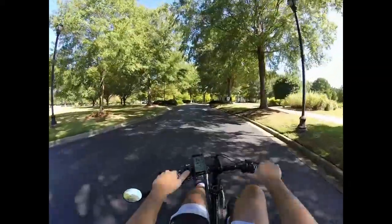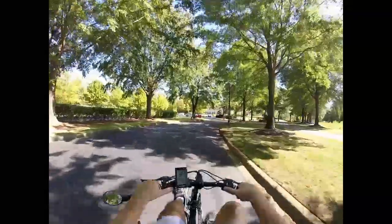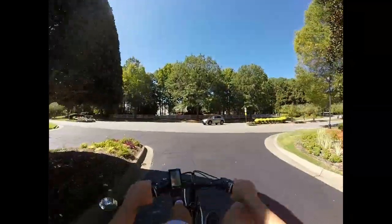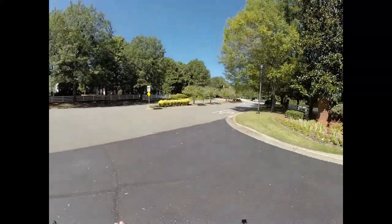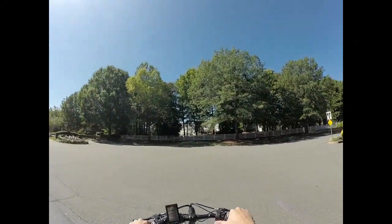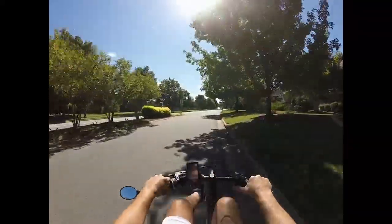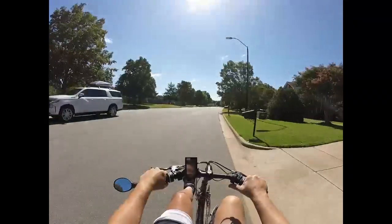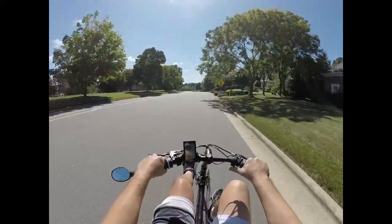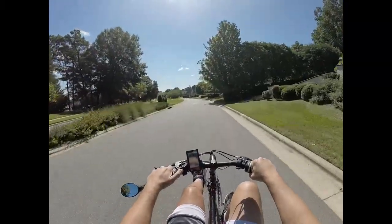23 amps, 24 amps, 24 amps. This is throttle only. 24 amps. The one thing I also had trouble with was on uphills from a stop. So I think if I can give it a little throttle and then get my feet up to the pedals, we're good. Gives me a lot more time. So this is 24, 23. The hill drops off a little, you can see 24 amps, 26 miles an hour. So if I go 4, 3, 2, 1, 0. I didn't even know there was a 0.